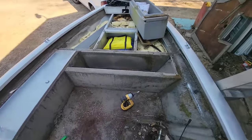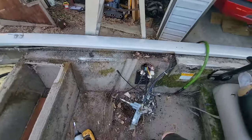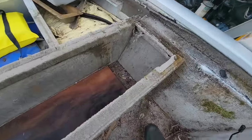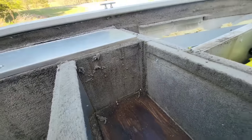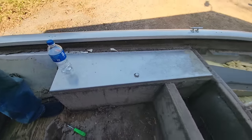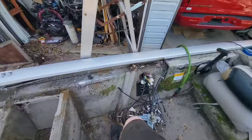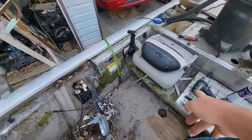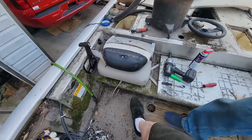That's going to come out too, to get the floor out. On this one we got it loose here, and along the floor it's got the hex bits, two rivets over here holding it in. We gotta take this one out first, then we can get this box, and then we can take these side pieces off. But I'm about to take the driver's seat off first to see if this whole thing has to come out.